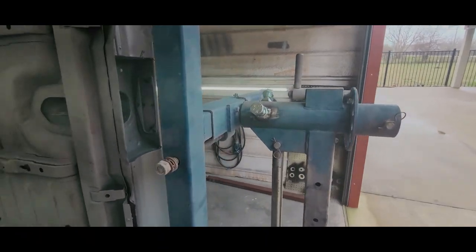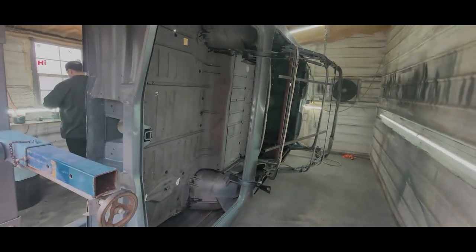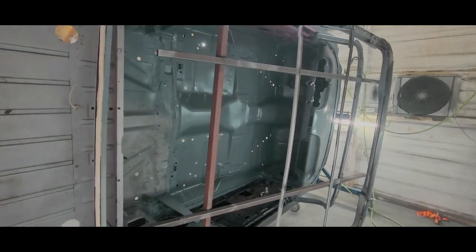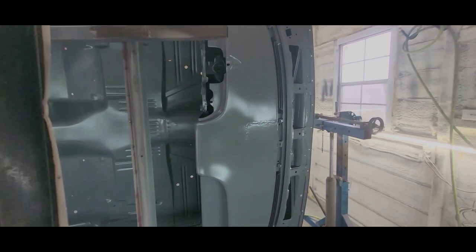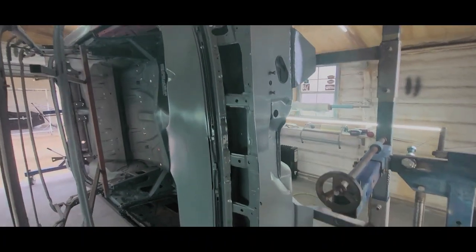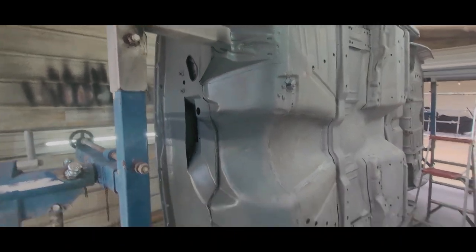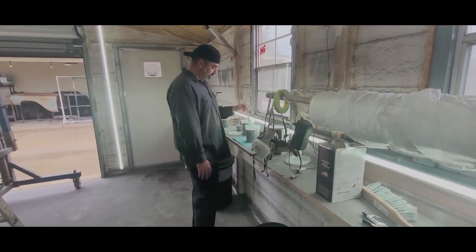So I like to let this stuff mix. We mix it and then we let it sit for like 30 minutes. What they call inducing it. And then we spray it. So I have some left over from yesterday. I have about 22 ounces. So we're going to spray that first, because that's been inducing overnight. And by then, we'll be 30 minutes in, and we can pour up what I just mixed here.